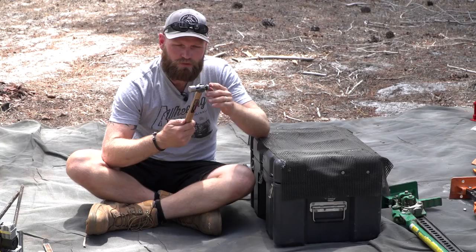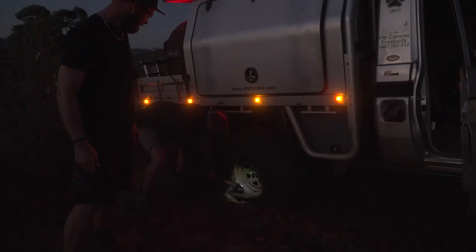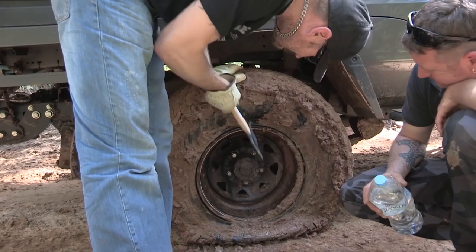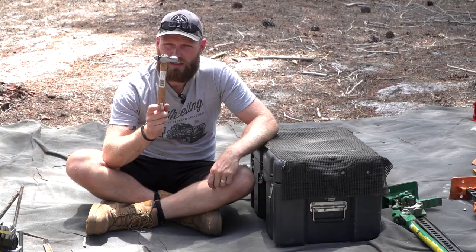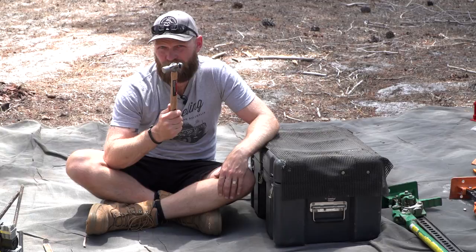This is a five-dollar hammer. Why would you need a hammer to fix a tire? This isn't to fix the tire — this is to fix your rim. If you have a steel rim, you can bash it back into place with a hammer. The best hammer to use is one with rounded edges, like a panel beater's or mechanic's hammer. It costs you nothing, you can also knock in tent pegs and find lots of other uses for it. For most small dents on your rim this should do the job — and you should only really get small ones.